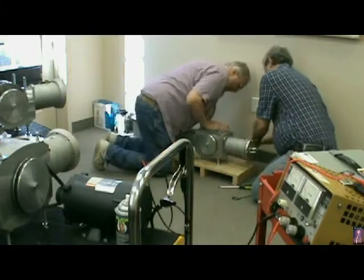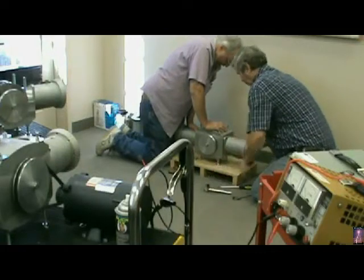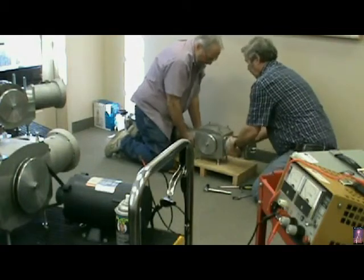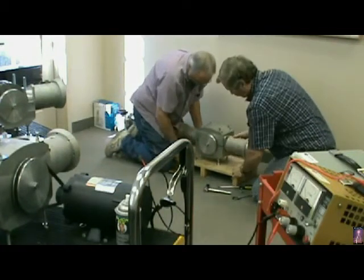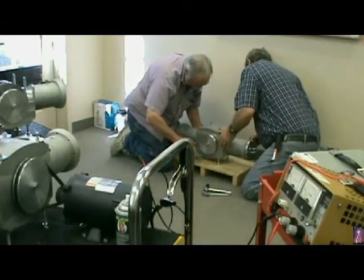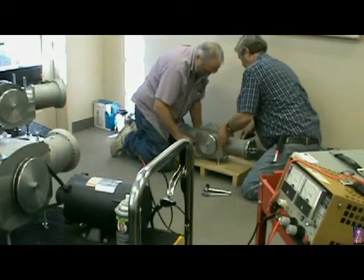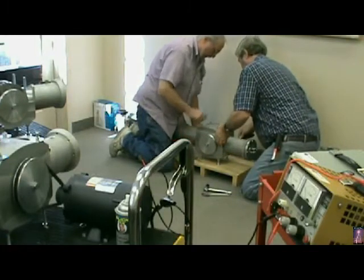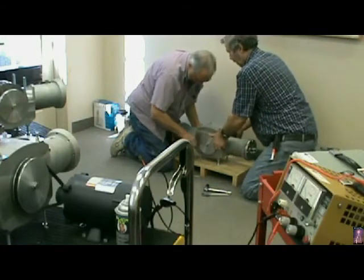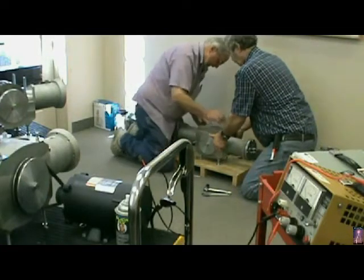That one. Yeah. What he's saying is just lift up on this and it should. Yeah. No, on the cylinder itself. There you go. Now you've got some place to put your screwdriver. If we're real smart, we can get this to go straight up. But you have to put your screwdriver under the side and knock your cylinder back down. Yeah, I got mine out. Okay. And you can leave this in here. Pop the cylinder on top and it'll drop down.